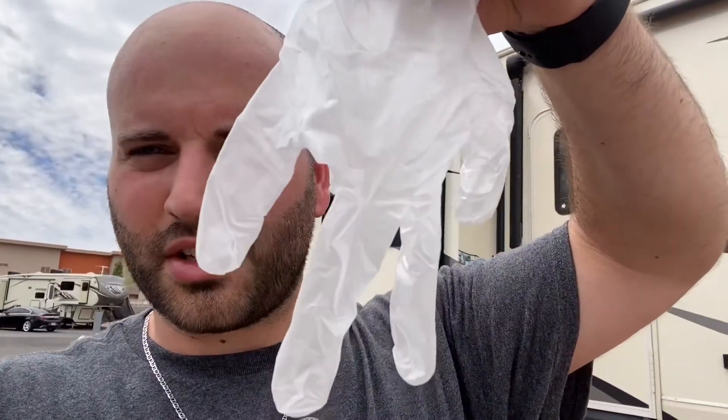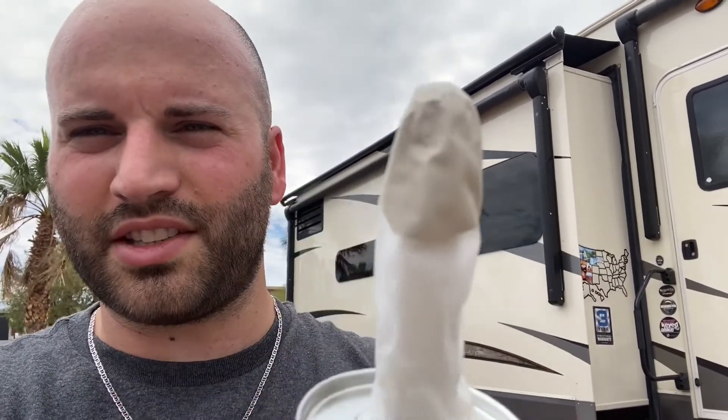I can't take credit for this — I found it on YouTube — but I discovered an amazing way to seal your Dicor or whatever caulking you're using. A lot of RVers, you know we have these rubber gloves for the poop, so all you do is take some scissors, cut that off, cut off a finger, slide it over, and with your caulking gun you can see right there — just get some in there and that'll seal it. I'm going to see how this works because I do have more work to do on this.